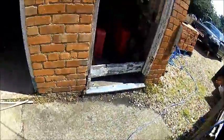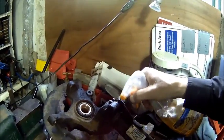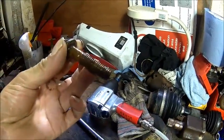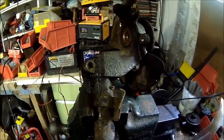Wait until the spring is dry because we just painted it. Give it a bit of paint so at least it doesn't rust as badly anymore. Let's see if we can get that other bolt apart in the meantime - soaking some more WD-40. We got it out - it was quite hard work actually. A long breaker bar and the impact helped at the end. It was just rusted solid. Clean that, grease it, put it back. Now use the chisel and split that and pull it out.